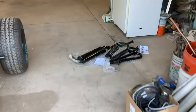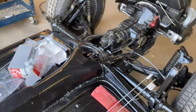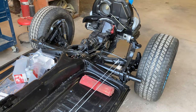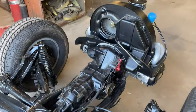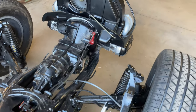Before we test fire it, I've got to get the exhaust on. And I'm going to get the driveshaft on to see if the transmission is all good as well. These are going to be our brakes — I need to make sure they're tightened up. We don't really have any working brake lines as you can see, but we need to see if it will move and go before we start putting more money into it. The engine is new, that will run. I'm not worried about that. I'm worried about the starter and the clutch assembly. So I'm going to get the starter in, get the exhaust on, the driveshafts, and the pedals in. Then we'll see if this thing will fire.